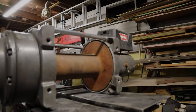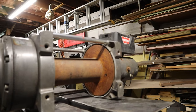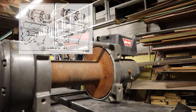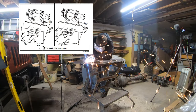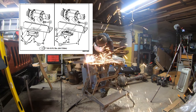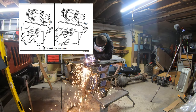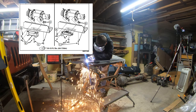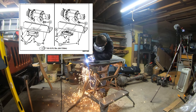But what you're gonna notice throughout this video is that it mounts differently than any winch you're probably used to, unless you're used to working with larger winches like this. If you've ever seen the Warn 8274, it mounts using four bolts on the face of the winch instead of four bolts on the bottom, like most modern winches do. And in the case of the M12K, that's because of the additional capacity, or at least according to the instruction manual that I found. So in posting pictures of this thing on the internet, the number of people that have told me I'm mounting the winch wrong is staggering.